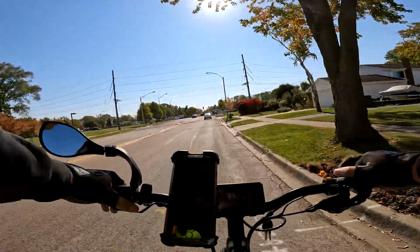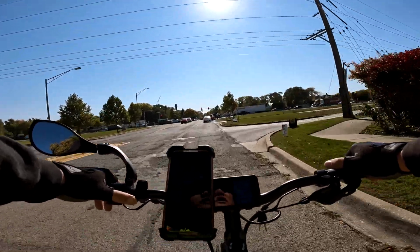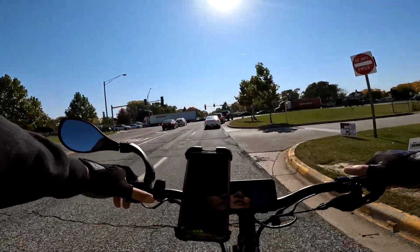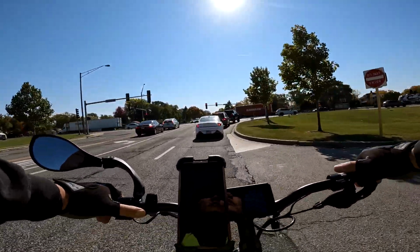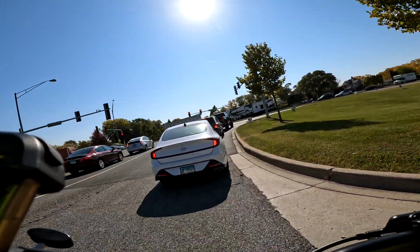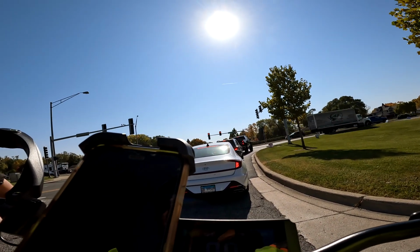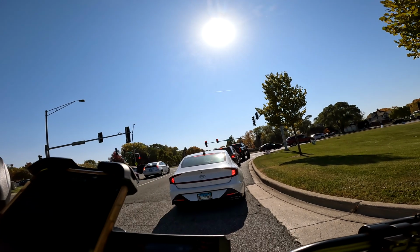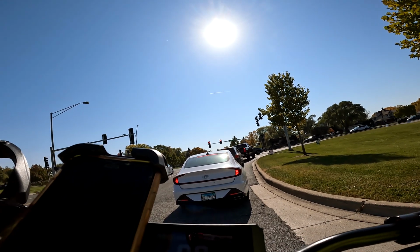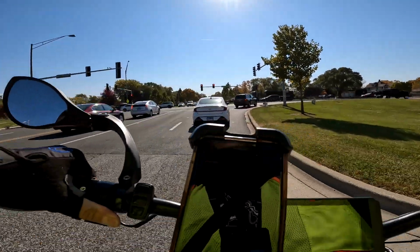Okay, and then we've also noticed that if you slowly charge the battery, it's actually better than the fast chargers. Now, when I bought these two batteries, I specifically told them I wanted the 2 amp hour chargers. I did not want their 4 amp hour charger, because I know that if you overcharge and if you charge quickly, it puts more of a strain on the batteries. So although it takes longer to charge, it's actually safer for your battery. I don't like the fact that it takes forever either, but I don't want to risk the fires or the problems either.